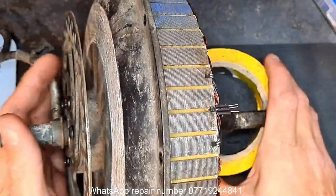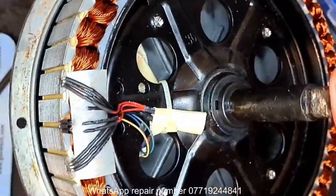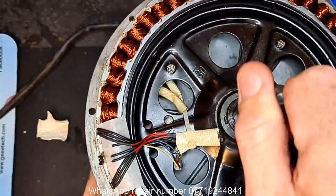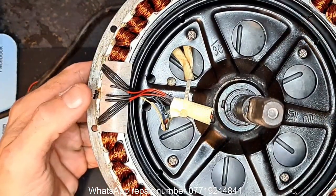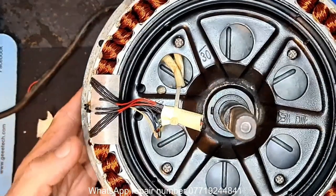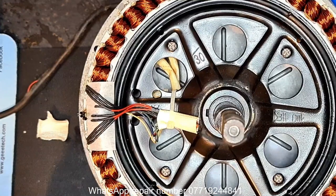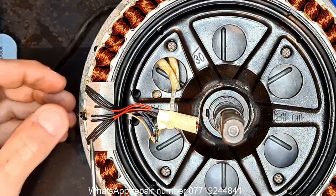Right, so we're sealed up there, up until that point. So let's rotate the motor back round and get that in a position. Right, I'll bend these over now, but these are our legs. What I need to do is put something underneath the sensor as I bend it to get a good bend and not just flex in the actual pin. Otherwise it just leaves tension on that pin constantly, which is not good really. It just naturally wants to come away from the pin forever, so best to get that tension out.